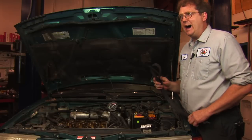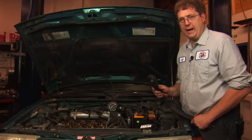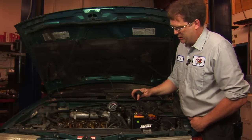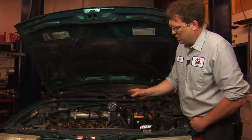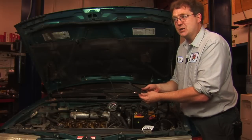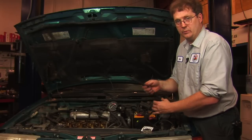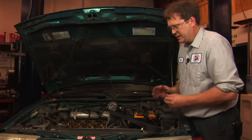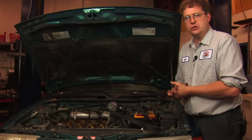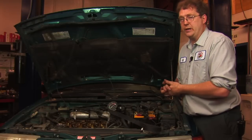Customers will often ask how they know if the timing belt is going bad. It's very difficult to tell, because for instance with this timing belt — a typical one with cogs on the inside — we can inspect part of it and it looks pretty good, with no immediately obvious cracks. But the truth is, if we look at this end of it, the belt has actually broken in two, and this vehicle stopped running because the timing belt had broken. So one thing to consider is that timing belts have a recommended service interval at which they should be changed — depending on the car, that interval could be every 60,000 miles up to 120,000 miles.